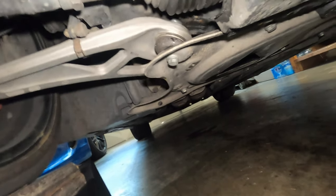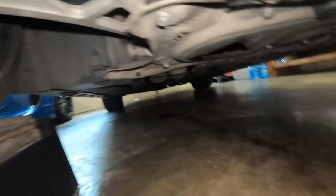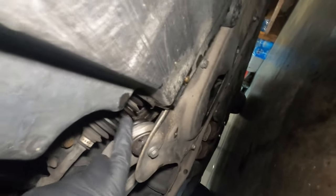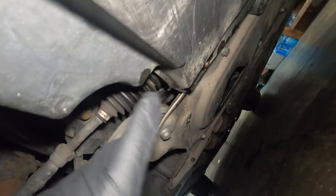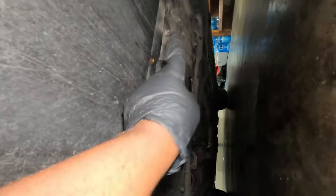This is day two. What we have to do now is jack up the car, put it on some jack stands or ramps like I have right here, and remove this underbody cover — it's a bunch of 16s. Remove this top cover; you don't have to remove the last cover. We're going to be working under here and accessing the headers from the top, because there are a few bolts we have to remove from the bottom that you cannot access from the top. We are also going to remove section one.